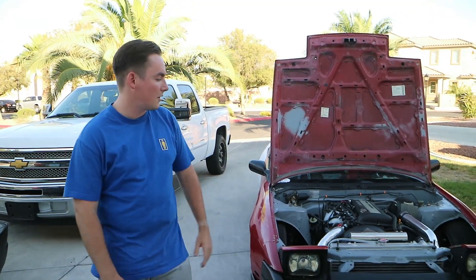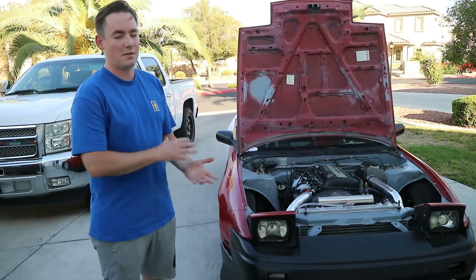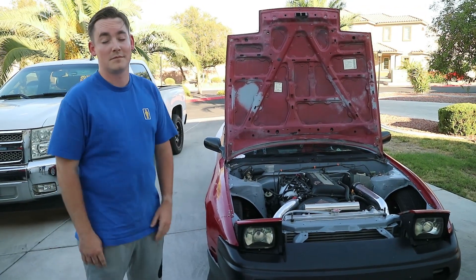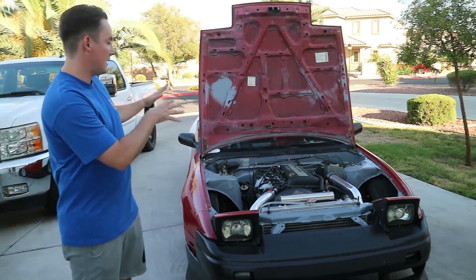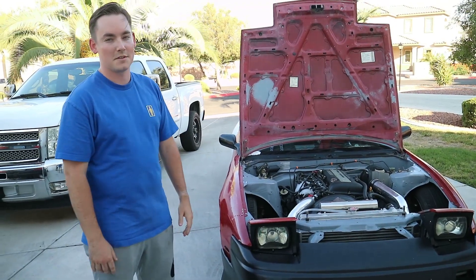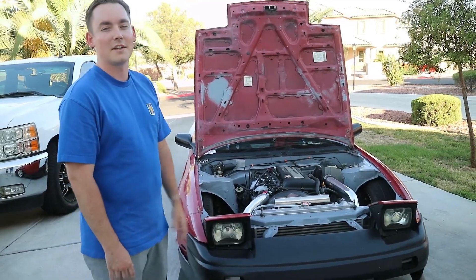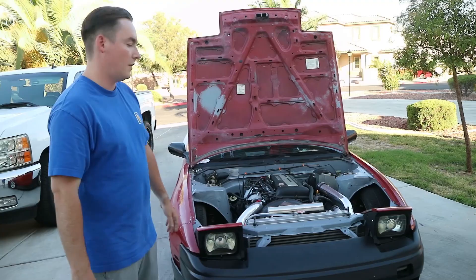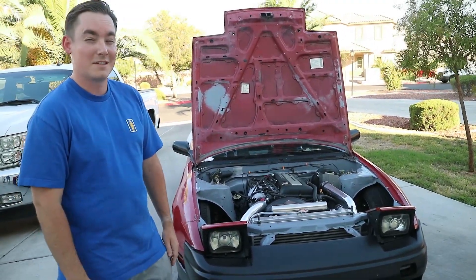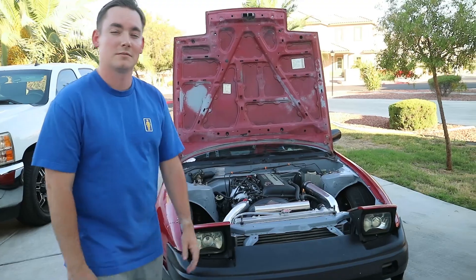Moving forward with the car, there's a lot of stuff I still need to do. This winter I'll probably refresh all the suspension bushings and wheel bearings, and maybe do an angle kit if I have enough savings. There's stuff that's definitely not correct — my brake line to the booster is collapsed because it's Home Depot tubing, so I need to get the right tubing and put a check valve in there. But yeah, for now it's a lot of fun. It's Vegas Drift Tech legal, so as soon as things get back to normal and we can go to Vegas Drift, that's where I want to drive it. Thanks for watching, guys.